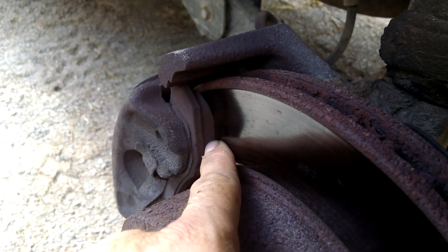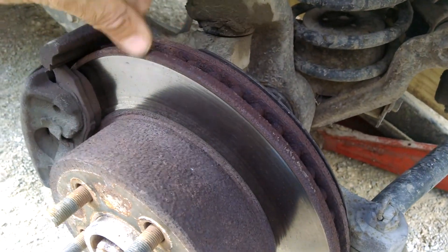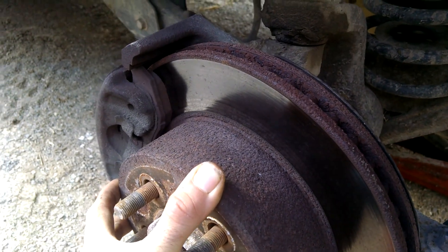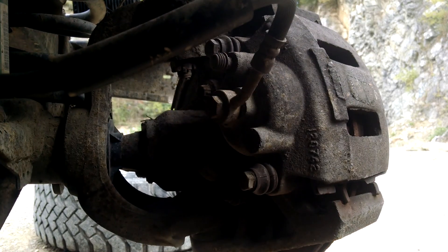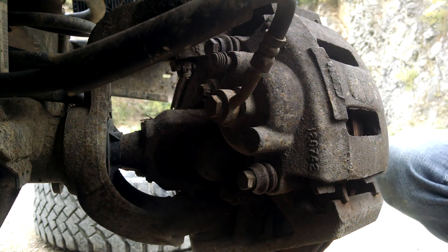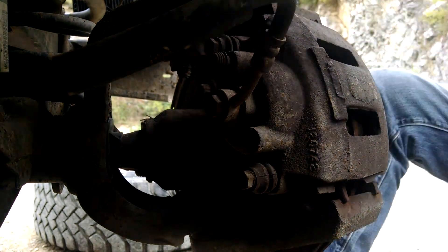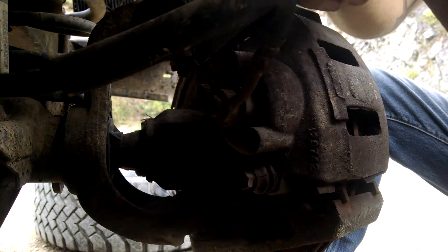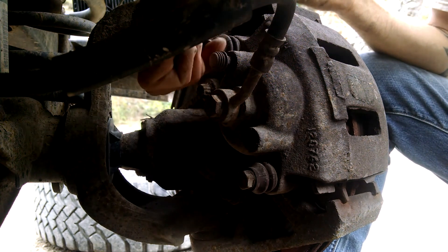This piece in the middle is the brake pad. They're pretty good on this side, but I know the other side was sticking so it wore it out. I heard the brake pads squealing so I'm going to replace them. You always want to do both sides at the same time — it's fairly cheap and easy. So that's the brake rotor, and you want to take it off — but watch out, that's the wrong size wrench.